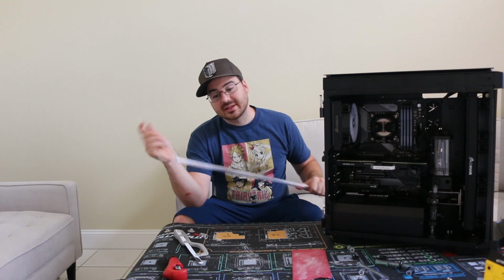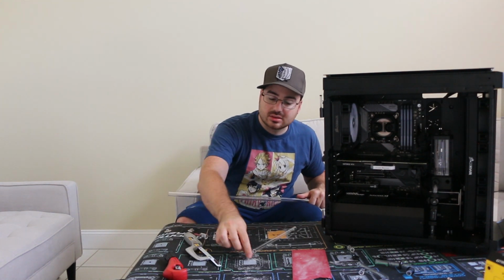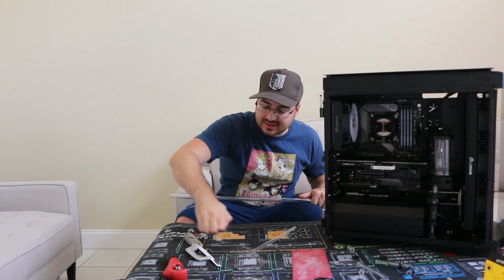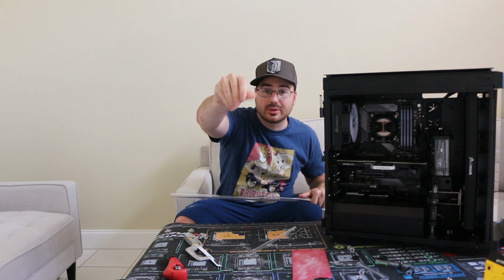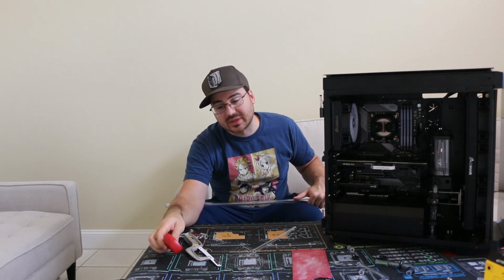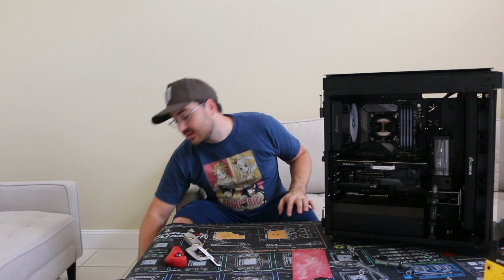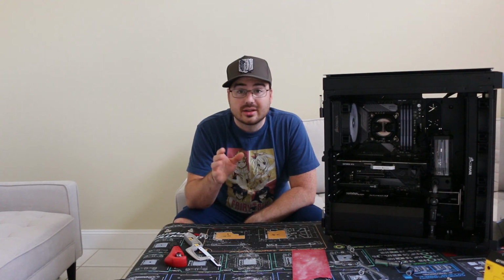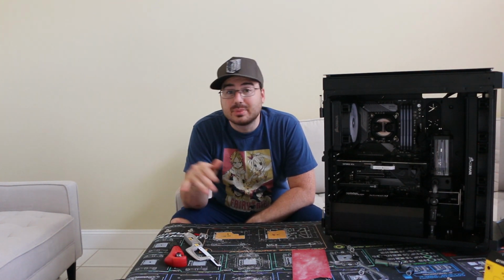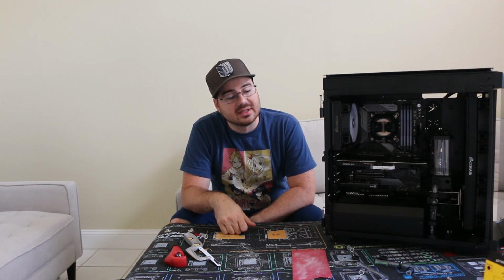You see that? Another thing you saw when I was cutting with the hacksaw, all that dust and particles from cutting makes a big mess. So you're gonna have a bigger mess to deal with when you deal with acrylic than you do when dealing with PETG. Now that's it for the tubing. I do recommend removing the acrylic from your cart before purchasing, and get the PETG separately, because it's much easier to work with, especially if you're a beginner.